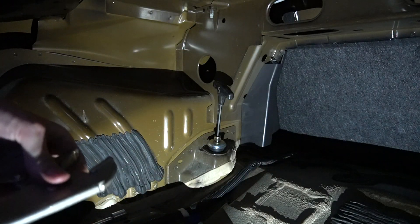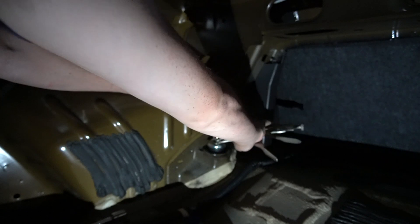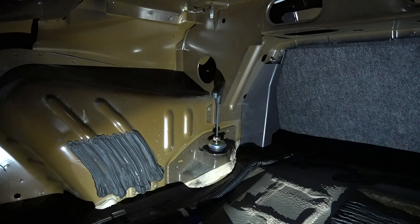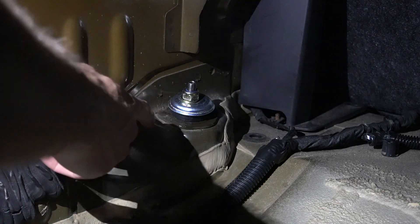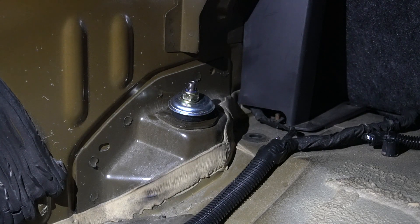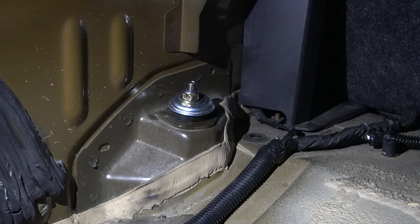You might be asking yourself, wouldn't this be easier with a 17 wrench? Yeah, but it's almost 9 o'clock and nowhere's open. This is going to take forever — I'll be back. This is where I'm stopping for tonight; I need to borrow more tools. Make sure you put some type of lube — not WD-40 or brake cleaner but an oil-based lube, or silicone should be fine — on your bushing so when it slides in it doesn't catch. Just a little dab on your finger and rub it around.